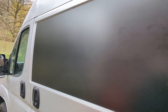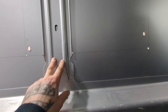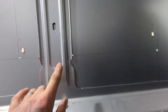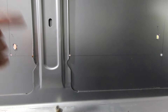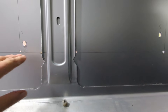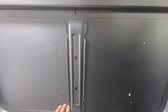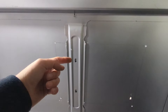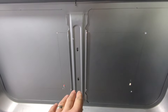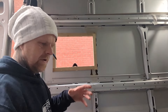Now for the side door window — because I'm going through the beam, I've put two pilot holes either side of it. I might have to cut on the outside of the panel to go through this because I won't get a smooth finish running the jigsaw across the side of the beam. If I can't get through from this side, I can go on the outside, put a straight edge across those two pilot holes, and cut it out that way.